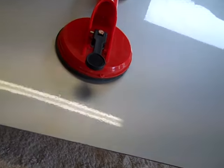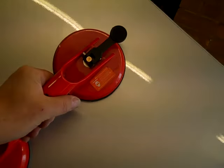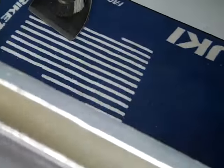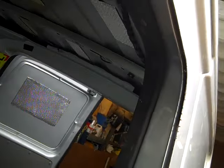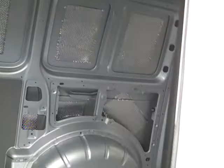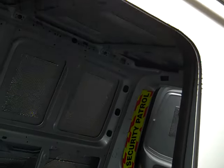Right viewers, that's that panel out. Makes it a lot easier when you can grab hold of something, because it's quite an heavy panel that, with that reinforcing rib in there. It is quite a weight. So what I've got to do now is try and close this gap up. It is quite a size. I'll go down with mole grips, try and close that gap up, tidy it up with file because it's a bit sharp, and paint some primer on to stop that rusting, just in case any damp does get into it.